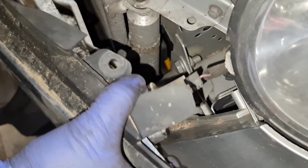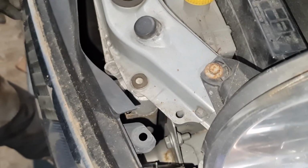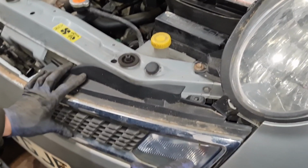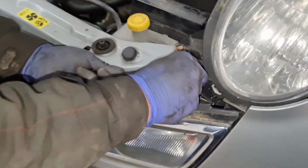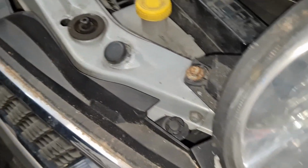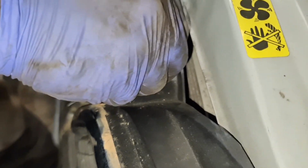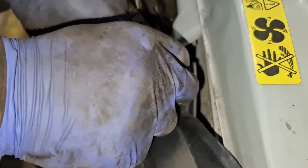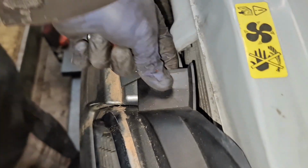So then to my right again. I then line these up on the inside. Make sure they go through the cushion clip. That's it. What I now do is slot the clips back in and push. They are quite brittle, so they usually do break. So if you can get new ones, brilliant. Otherwise, if you can't get a hold of clips from anywhere, just cable tie it, put a cable tie across it. That's it.